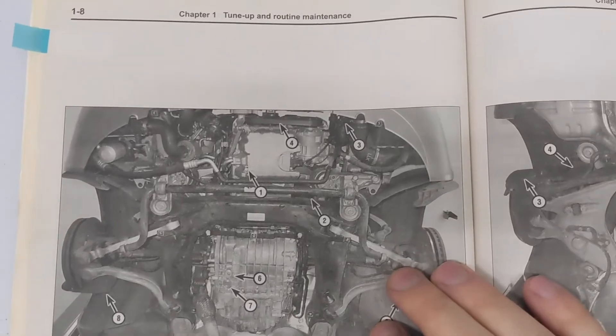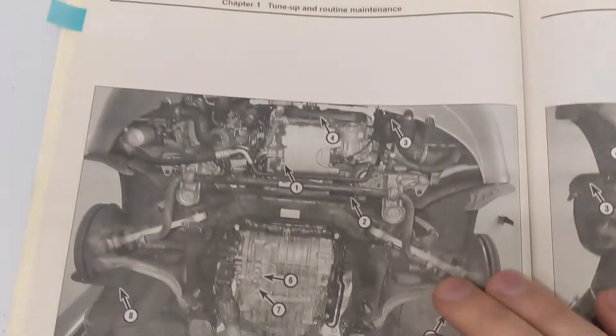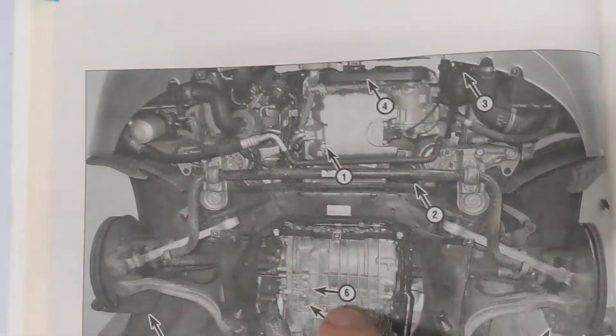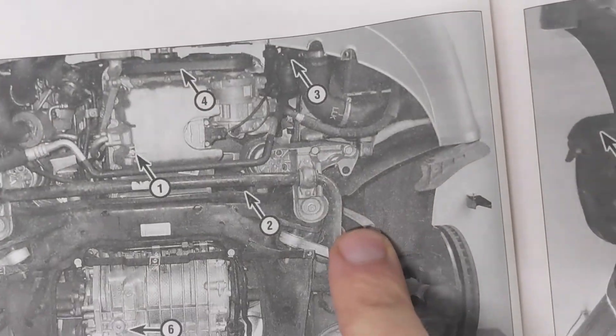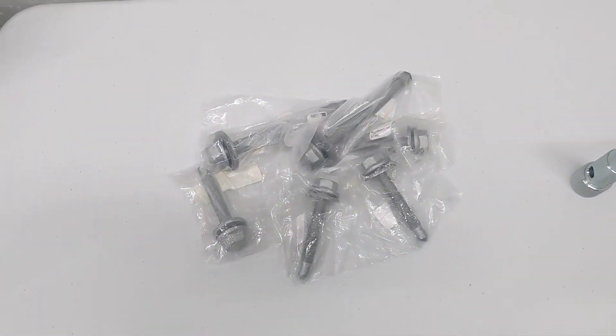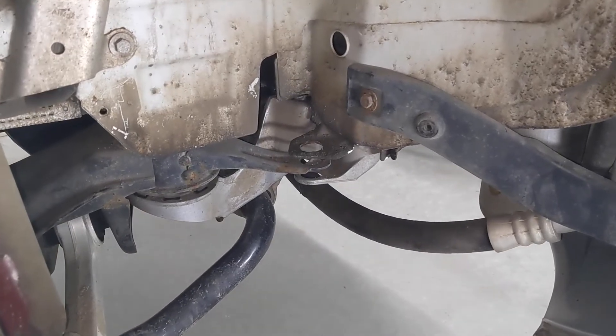Mistake number one to fix is that I didn't pay enough attention to the alignment holes. The second mistake is a matter of due diligence. All three bolts on the front brackets that hold up the motor mounts are torqued to yield, and I didn't replace them last time. So I'm trying to be a good example here, and this is absolutely the best time to go back and do this. Just for fun, let's see how I did with the eyeball method.